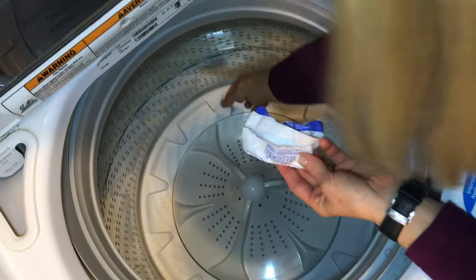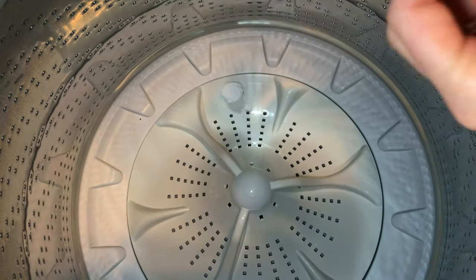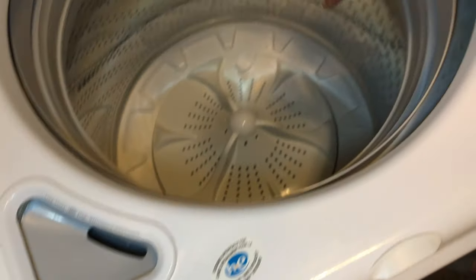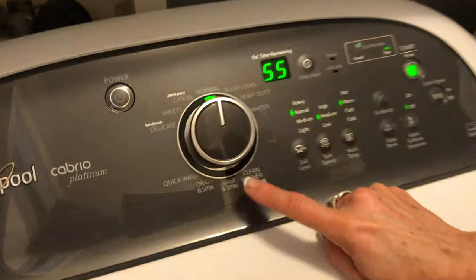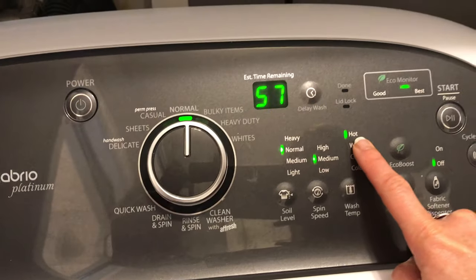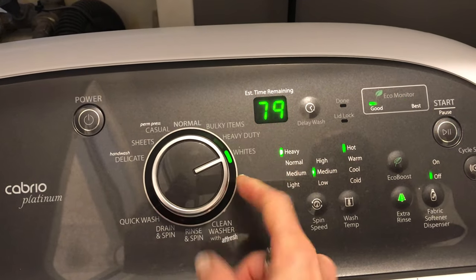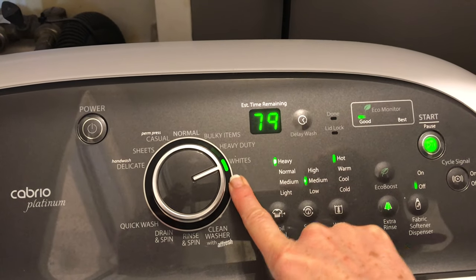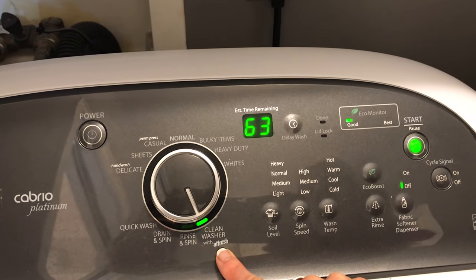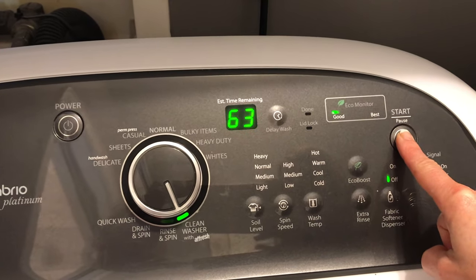Turn on the power button. You're gonna stick your washing tablet down in the bottom of the washing machine. I have a little bit of powder that was in the package — I'm just gonna pour that all in. Do not put it into the dispenser; you're gonna put it into the bottom of your washing machine. I have a cleaning button, but if not put it on the hottest and longest cycle you have — like the white cycle. Hit the start button and now it's gonna start the foaming action inside the washing machine, run through the whole machine, and clean out the debris and dirt.